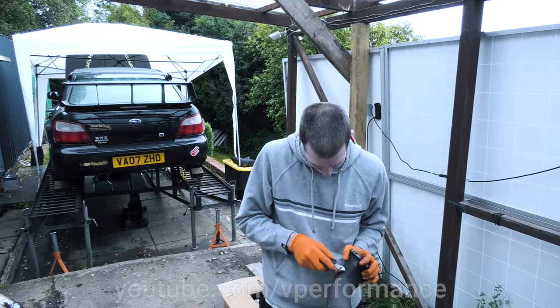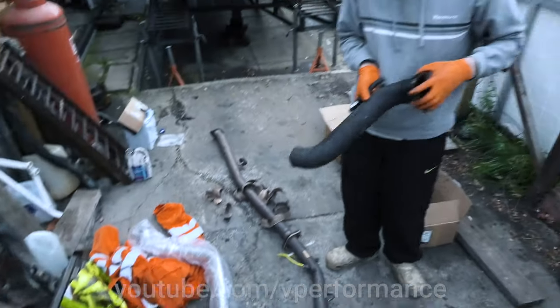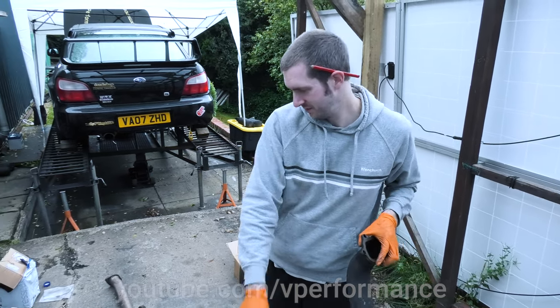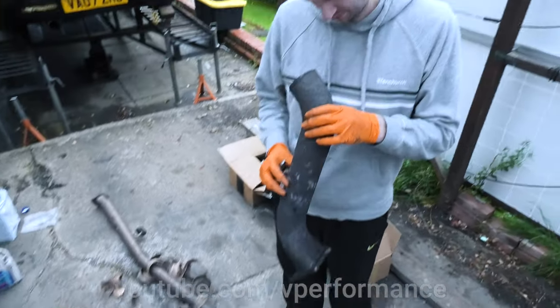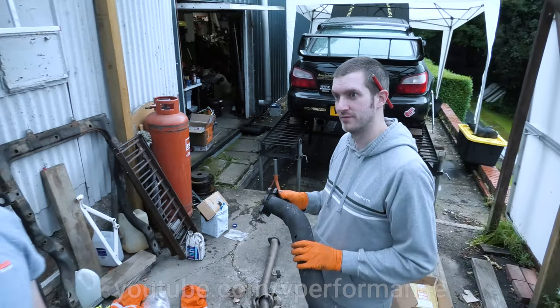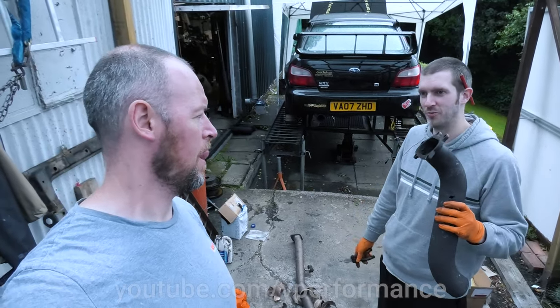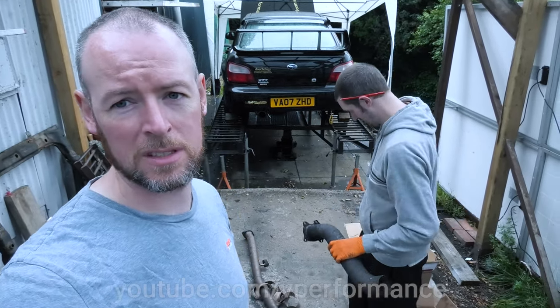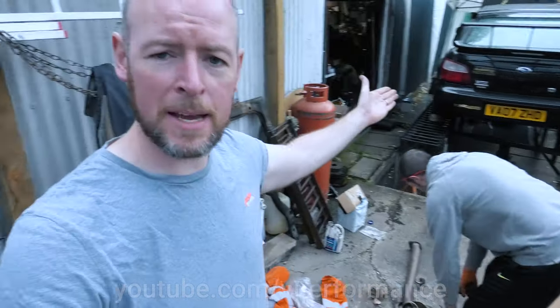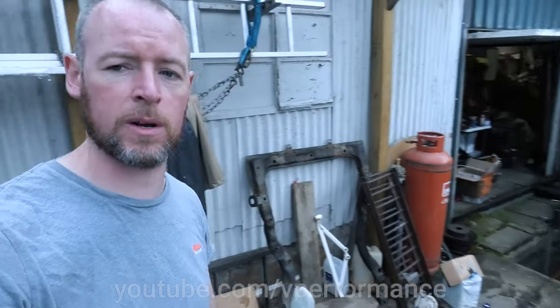I've got good news for you David - the replacement is a single-piece Jackspeed downpipe. We will have to cut some bits off. So that's what happens if you heat wrap your exhaust - it just dies faster. It does work, but it dies faster - because it's science. Ceramic coating is what you want instead. Is that mega bucks? Well, is it mega bucks if you're replacing your headers and downpipe every 15,000 miles? And if your car's in race conditions then I don't suppose it really matters. But this is a 70,000-mile Subaru WRX that is being made to drift because it's what we have. Cue Scottish weather - the rain will now ruin the audio. So we're going to say goodbye. Thank you for watching. Don't wrap your exhaust pipes unless you want to replace them every 10,000 to 15,000 miles. Thanks for watching, bye.